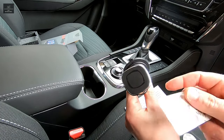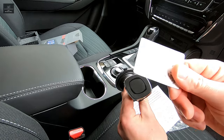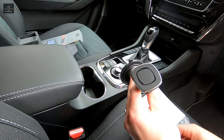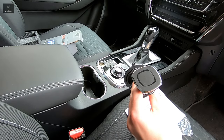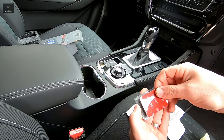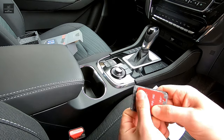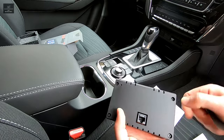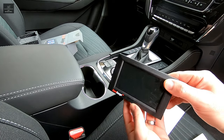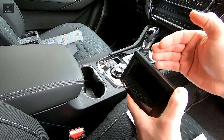The windscreen mount has a magnetic base. These two steel plates have a 3M adhesive side — you just place them on and they stick nice and firm, same with the circular one. We're going to use the additional tape that came with it to give it a nice firm mount on the ScanGauge itself. According to the instructions, place them on top of each other and press firmly until they stick — this will give us a nice bond. The next step is to remove the red film and place it on the back of the ScanGauge. I'll place it towards the left, which equates to the right of the actual screen, so our window mount can sit in the right-hand corner of the windscreen for a little more flexibility.